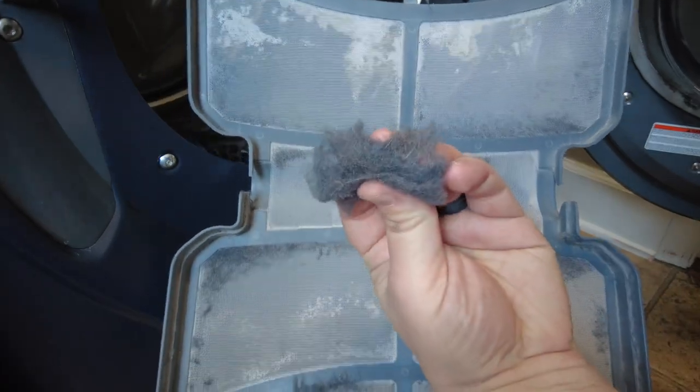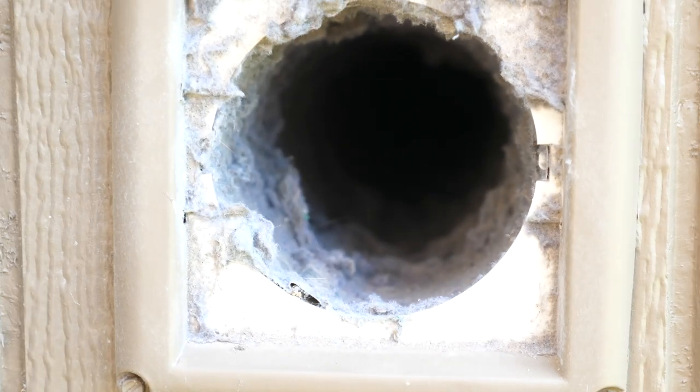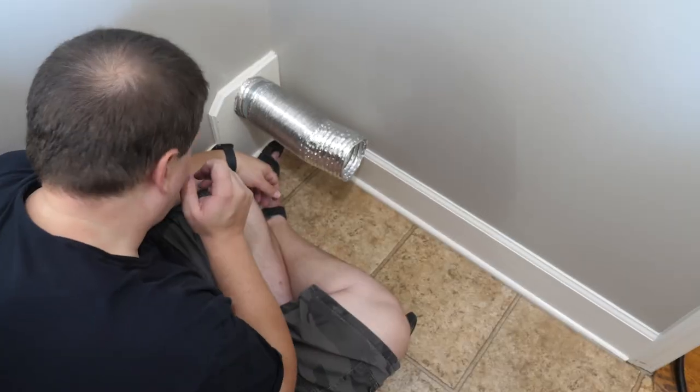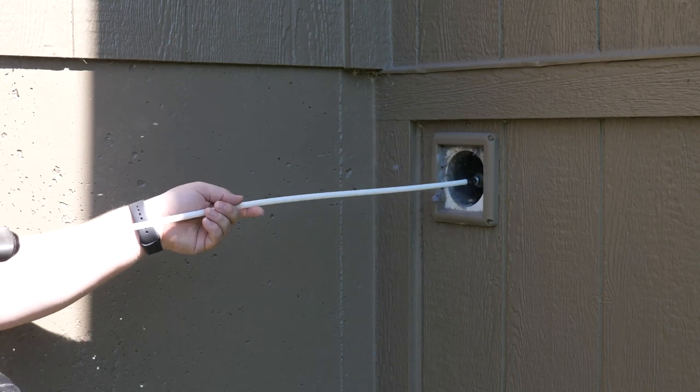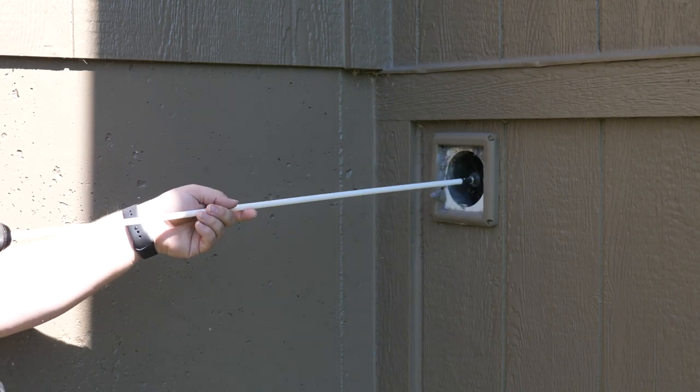To properly maintain your dryer, you should make it a habit to empty the lint trap after every drying cycle. You should also inspect and clean out the dryer vent and the hose, because these places can accumulate lint as well. Ideally, you should do this every three months or so, but even if you clean it every fall and spring, that's going to go a long way to preventing fires and making your dryer way more efficient. In addition to lint, remove any debris you might find in the hose and make sure it's not kinked, crushed, or damaged when putting the hose back in place. You can also get a dryer vent cleaning kit to help brush away caked-on lint — these are generally reasonably priced and can be used over and over again, so they're a really good investment.